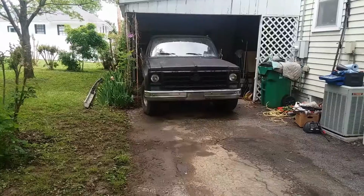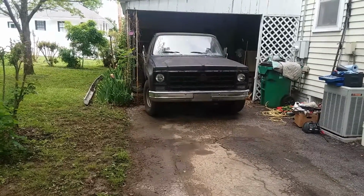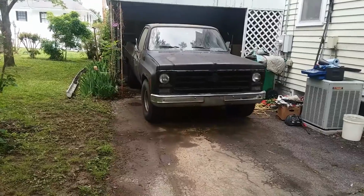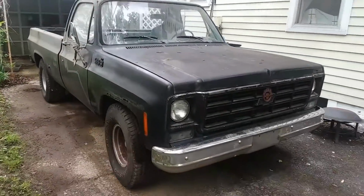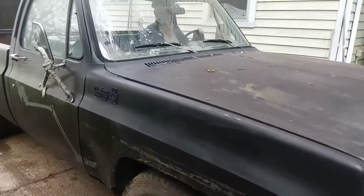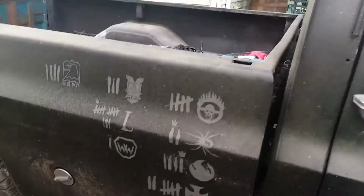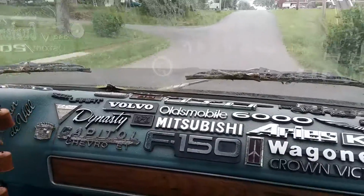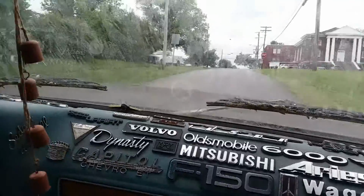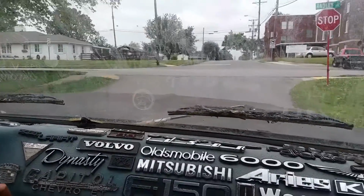And look at this, it looks like I actually did it. I basically just had to clean out some of the old gas out of the fuel filter, and we put some octane booster in the 2-year-old gas in the gas tank, bought a new battery, and put some transmission fluid in it, fixed a transmission leak, and here it is. It's out on the road, it's driving. We did still have some problems with it, as you can hear in a second, which means that I have to take the carburetor off and bring it home.